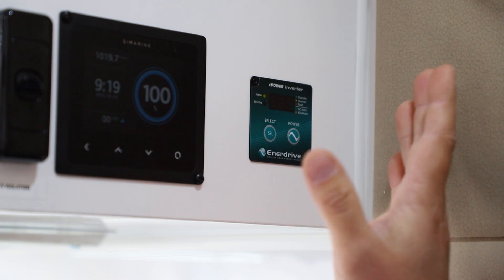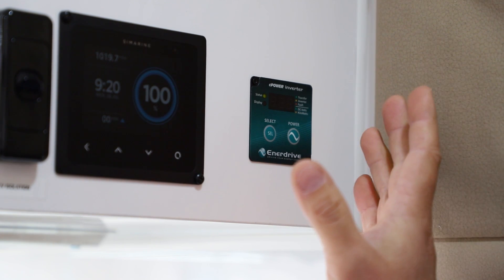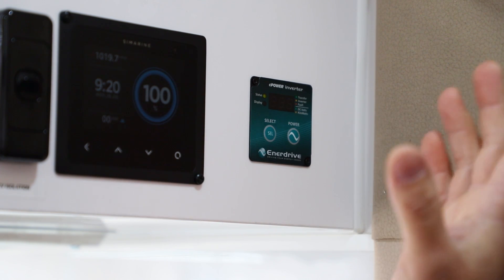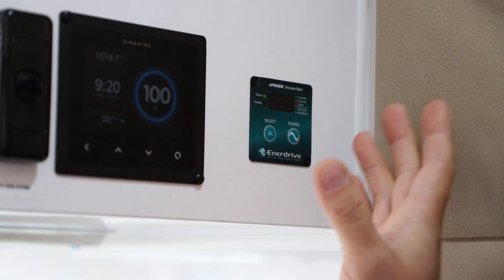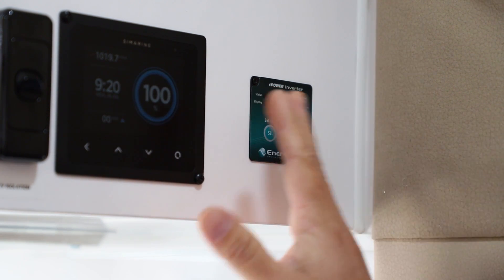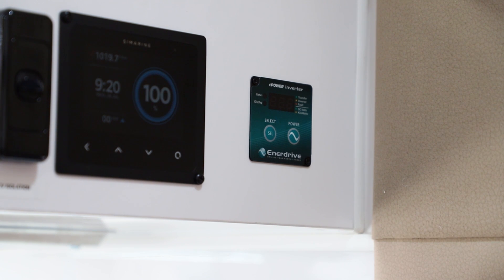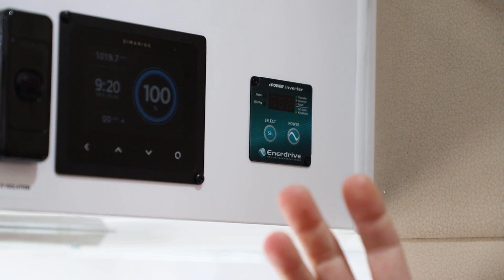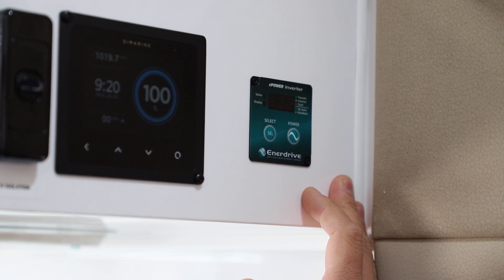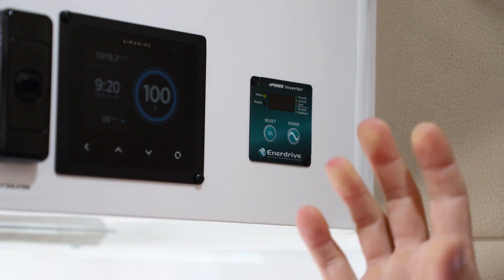That's without pressing any buttons, and that's why we like the PS6 functionality — a great application for when your van is in storage and you still want some power on. However, the inverter function will not work in this mode. If we turn the mains power off, all equipment loses power immediately. This is great for storage: if somebody pulls the plug, there's no residual power draw from the inverter. Turning mains back on, it qualifies the power again.